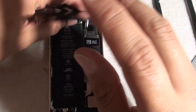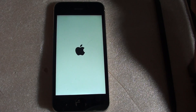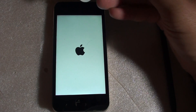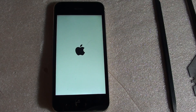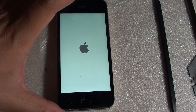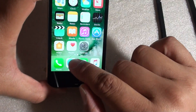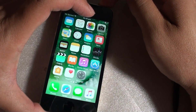I am going to plug in the cables and switch on the phone. Now the phone is switched on — hopefully it is not rebooting anymore. If it is still rebooting, we can try to figure out if the flex cable, home button, camera button, or LCD connector is the issue. The phone is booting up fine — it is not rebooting anymore.